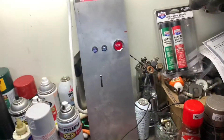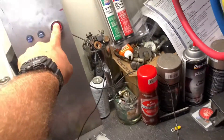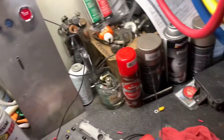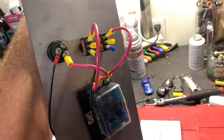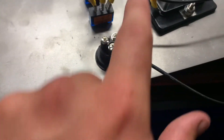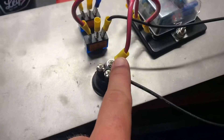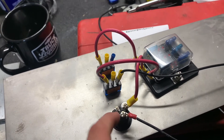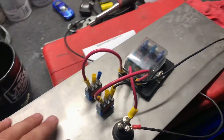This is my switch panel. Engine start is pretty easy: this is gonna be ignition and this is gonna be my fuel pump. This connector has numbers on it — ground is number three, constant 12-volt to the switch is number two, and the wire that's going to run to my starter to start it is number one. Pretty simple.